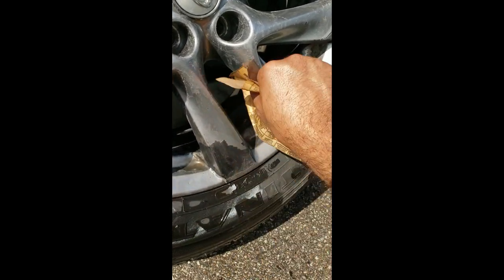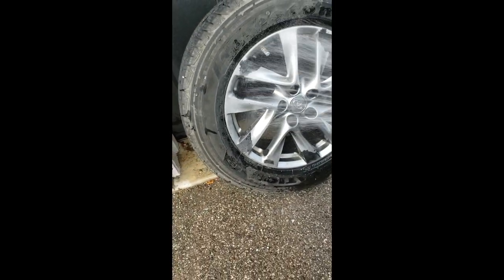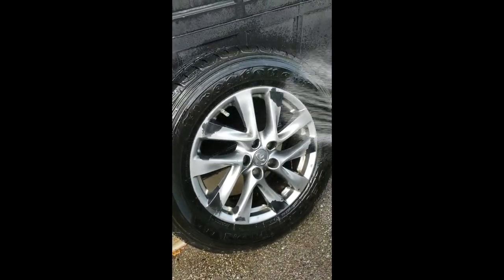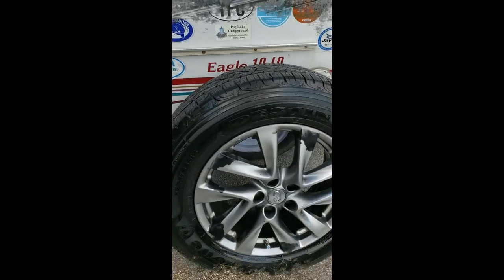You're painting on steel or aluminum, and you want this to be a permanent bond. As you can see here, I've given the wheels a good scratch coat and hosed it all off. You can see a significant difference — that clear coat and that paint was barely on the wheel, and it didn't take much to actually take it off.